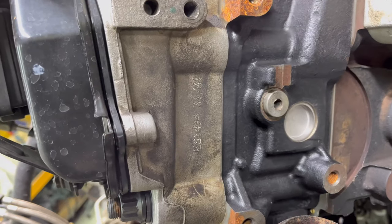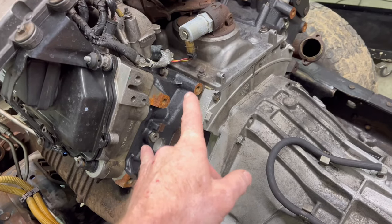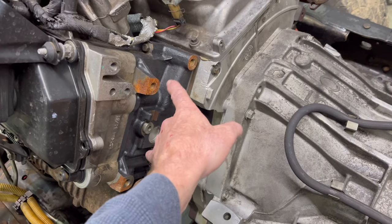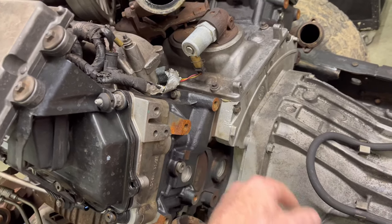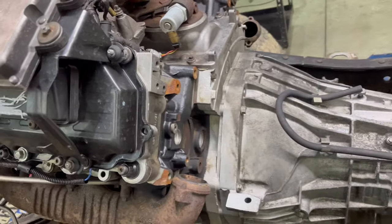When he got it back, it was pouring fuel all over everywhere. These cylinder heads are actually from Ron — he supplied those to the place that did the stud job. We're going to back-test them, but we're not going to rework these heads. We're just going to give them an eyeballs-on inspection and check them out, see if everything looks all right. And if it does, we're going to clean them up and put them back in service.